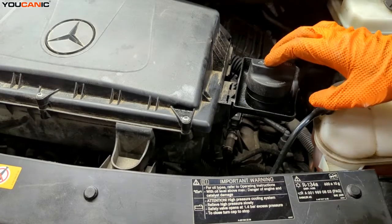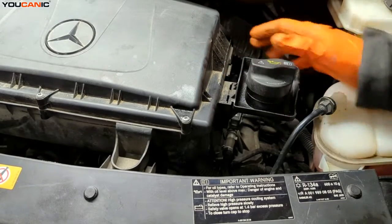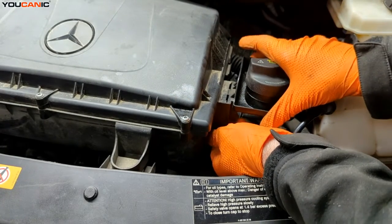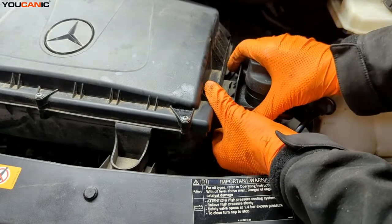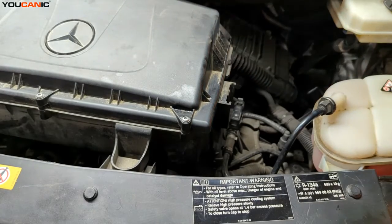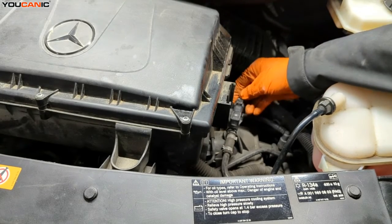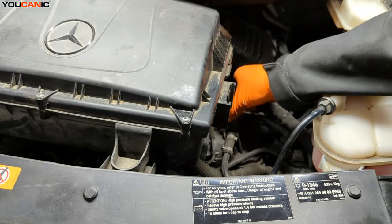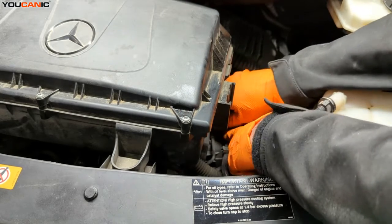This sensor is located down below the oil fill tube — where you would fill your engine oil. There's a little tab at the bottom; press it toward the interior of the engine. Once you do that, you'll be able to pull it up and set it to the side. There's an electrical connector — pull back the little tab, squeeze it, and unhook it. Then turn it 90 degrees and you'll be able to pull the sensor out.